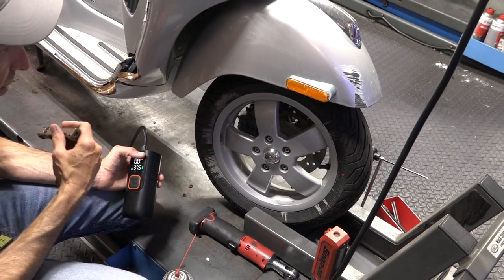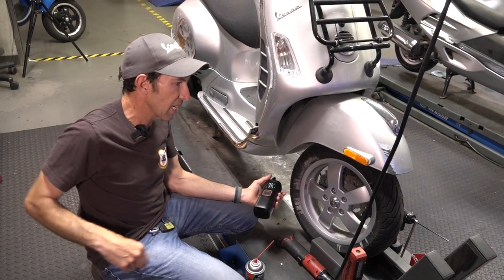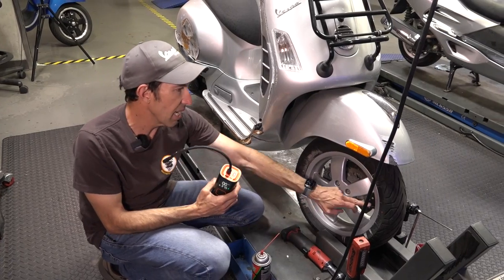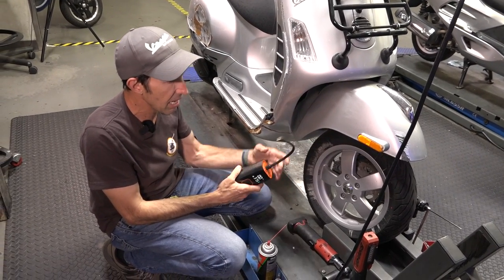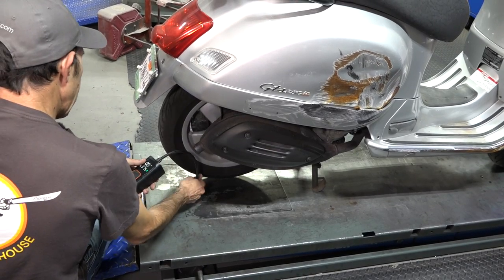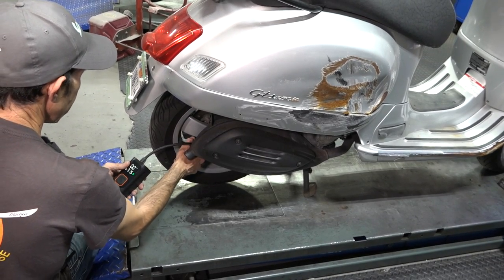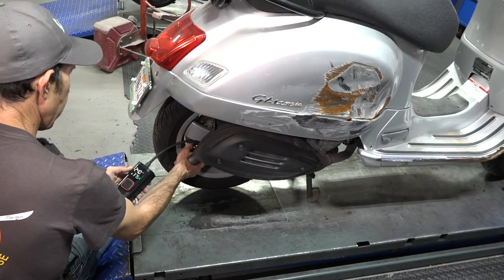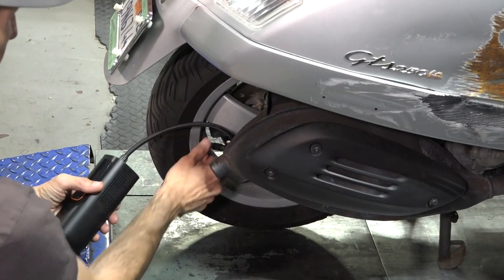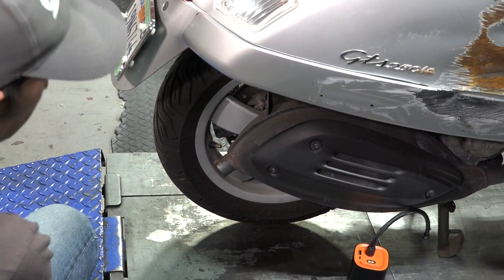I'll check the rear tire as well. The rear tire is exposed to a lot more heat and wear because it's a drive tire, so that's the one you really need to check and you don't see it as readily as the front tire. Check the stem, tire tread, the tire for any debris, and most importantly the pressure. The GTS has it on the center stand — the tire has less than 500 miles on it. The stem cap's missing, which isn't good. Pressure is pretty good — 32 to 34 psi. If you're going two-up, go up to maximum pressure of about 35 to 36 psi for a GTS.